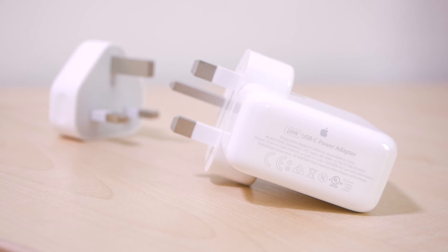The recommended way to fast charge the latest iPhones is to use Apple's own expensive 29W USB-C charger. If you own a 12-inch Apple MacBook, you already have one. The latest MacBook Pros also come with a USB-C charger which will also work, but it won't be any quicker. The 13-inch MacBook Pro comes with a 61W charger and the 15-inch MacBook Pro is supplied with an 87W charger.